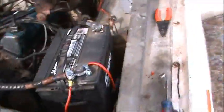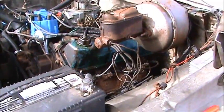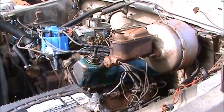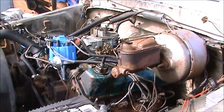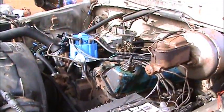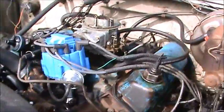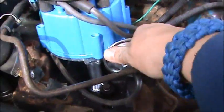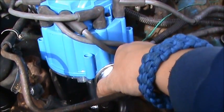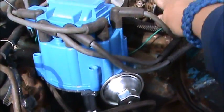I've got to find the mark on the crank balancer and mark it. Let's get it set. I can't remember what this one sets at — I'm wanting to say 6 or 16 degrees. I'll tell you in a little bit what a 400 sets at; I'm going to have to go look in the book. Let's play with it a little bit. That's too high — see, it starts jerking. I'm going to bet that right in there is probably going to be right.